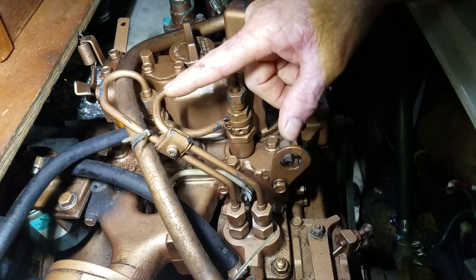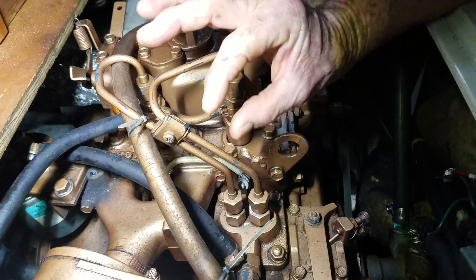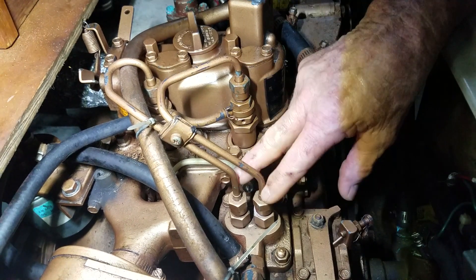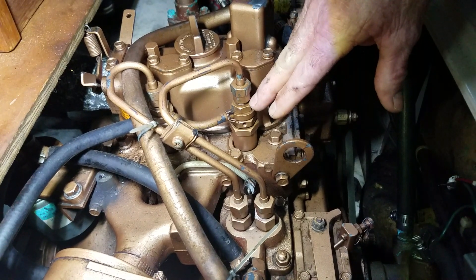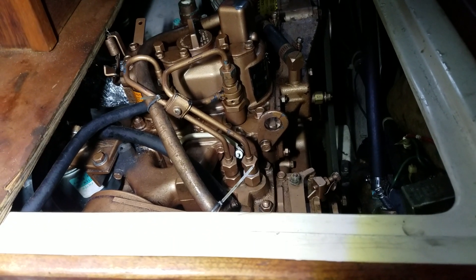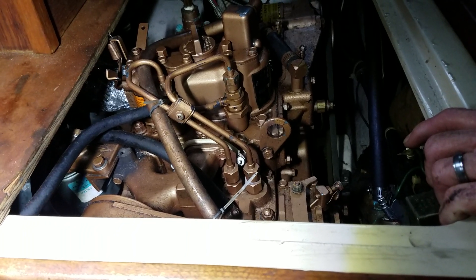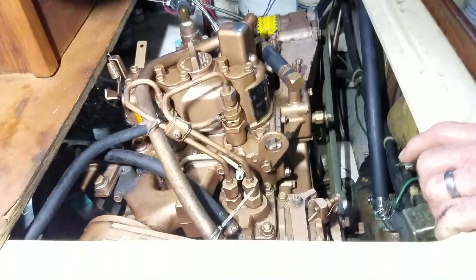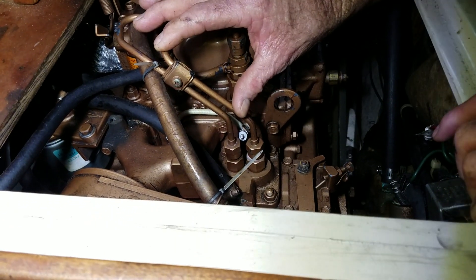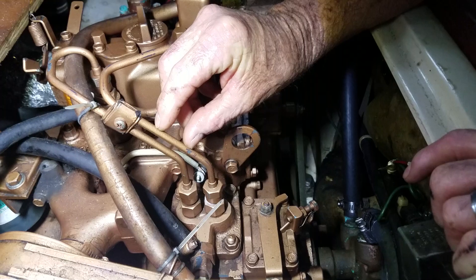This is a complete hydraulic system. Liquids don't compress — air does. You get one bubble in here this big, and the volume of each firing cycle is minuscule. It's like scuba diving: when you're 80 feet underwater, the air is highly compressed, and one little bubble on the surface becomes a huge bubble. You can't have a bubble in here — it has to be solid. The injector won't open because the pressure is absorbed by the bubble — it's like cushioning.